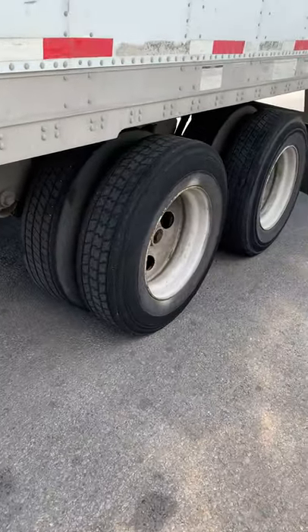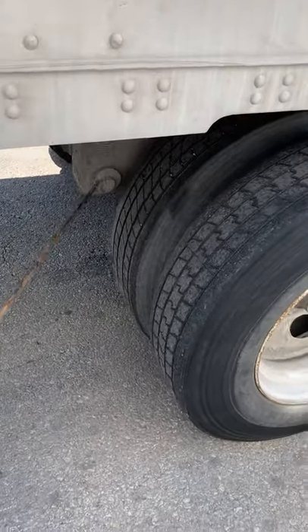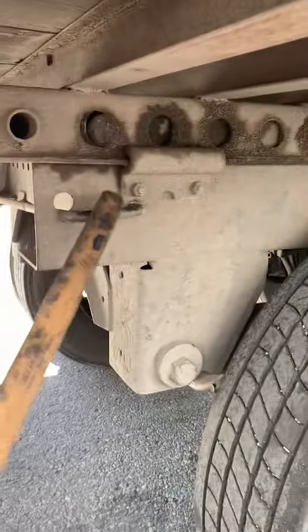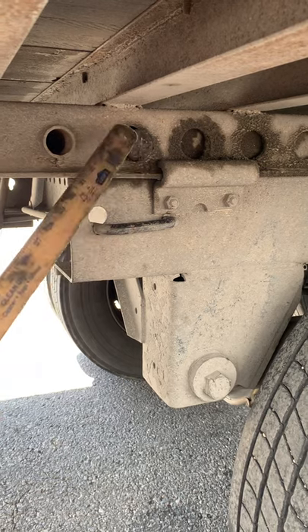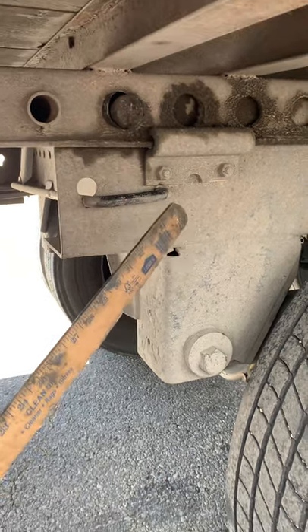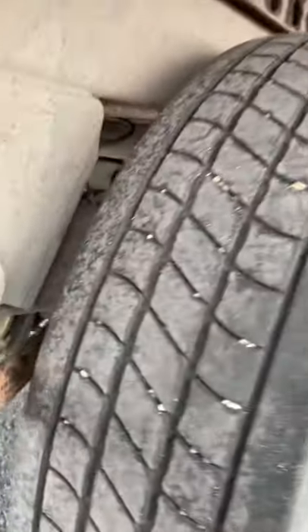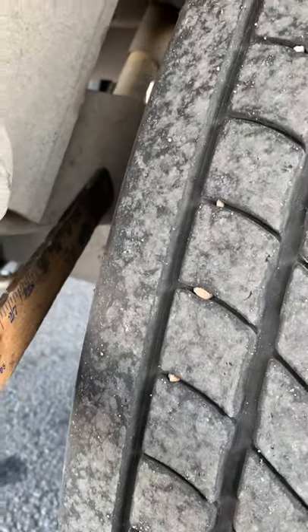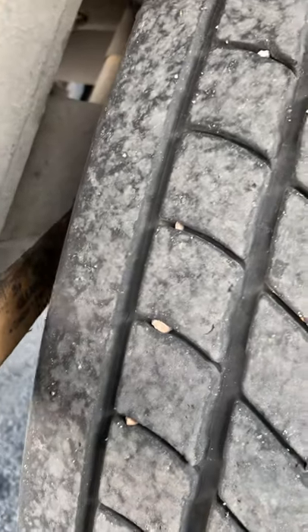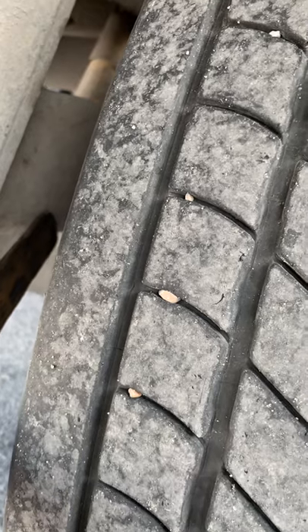Since this trailer is an air ride, you will state the air ride information. First, go down here and talk about your tandem release arm and locking pins — not cracked, bent, or broken, and in the fully locked position. Then from there, you go into your I-beam. I-beam is properly mounted and secured to the axle by welds or U-bolts — not cracked, broken, or having illegal welds.